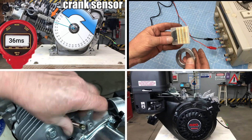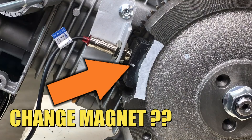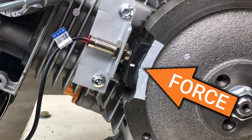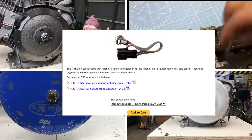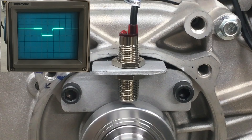Hope that makes sense. I reckon modifying the code is possible, but at this point I don't have the source code, and I don't want to go down that road because it's another barrier. Changing the magnet is something I wouldn't encourage — first, the flywheel would likely need to be rebalanced, and that would be more expensive than buying the correct sensor. Second, the forces on the magnet are not trivial, and there's a good chance a replacement magnet would fail, which may cause a lot of damage and would be very dangerous. So that's out. Other than buying the north sensing crank trigger for $55, the only other option was to abandon the flywheel trigger and fabricate an alternative method.